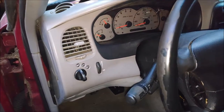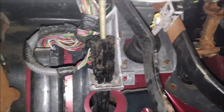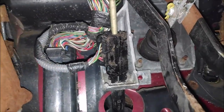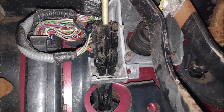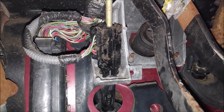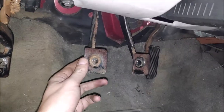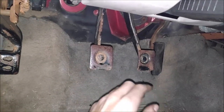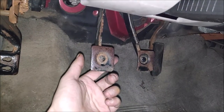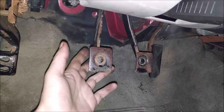Welcome back to Everyday Erase. Today I'm going to show you how to remove and reinstall a clutch switch — that black electric part that you have to remove. That's very common if you're replacing a master cylinder or clutch and brake pedal assembly, which goes out nowadays since the truck is over 20 years old. The bushings go bad so you gotta replace them. To get them out you gotta unhook the clutch switch so you can unhook the clutch master cylinder.